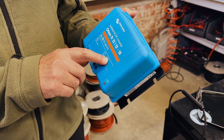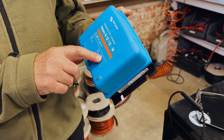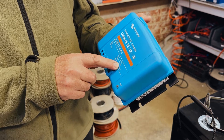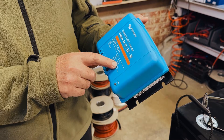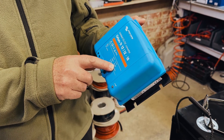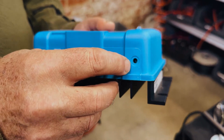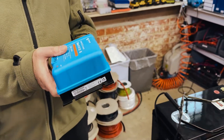One of the reasons is that the input is quite variable — from 8 volts to 17 volts, quite a big range. So if you drop down to 7 volts it's going to stop, but it has a very big input range and it's going to output quite a constant voltage. Depending on the model, it puts out about 12.5 volts as standard, and then you can adjust it plus or minus 15 or 25% by changing this little potentiometer screw, giving you a nice constant output to run your appliances.